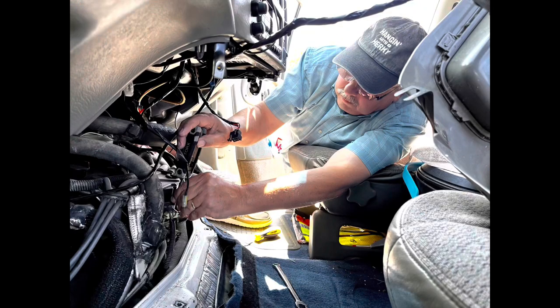All right, so the second thing that happened is as we decided to turn around and come home, we lost an engine in the van. Now, it didn't blow up in some big dramatic experience. We thought it was a distributor cap. It started missing because we were in a lot of rain. We were running on five cylinders, and I thought, oh, this is just an electrical issue. So we pulled over into an O'Reilly parking lot, and I worked on it a good 2 hours, and still couldn't get it done.